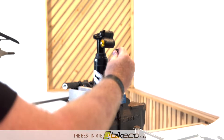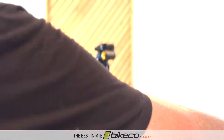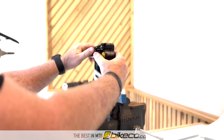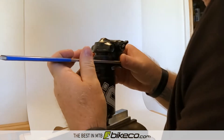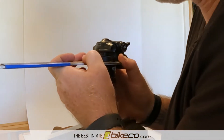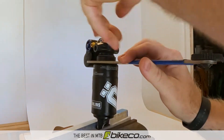With this shock it's a little different than some of the shocks I've worked with in the last few years. This is what's called a double air sleeve shock, and you can tell there are two models of TTX. One is a mono air sleeve and you open that with a strap wrench. This one you're gonna open with a bottom bracket tool — it's an outer can threaded onto an inner intersection.